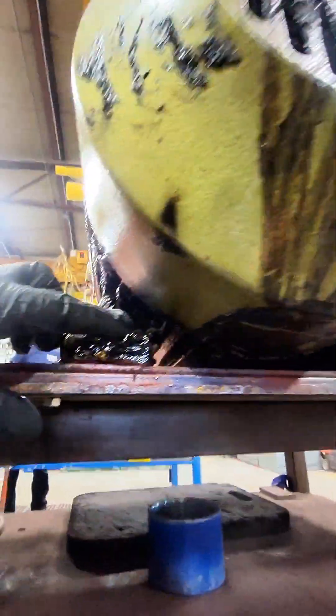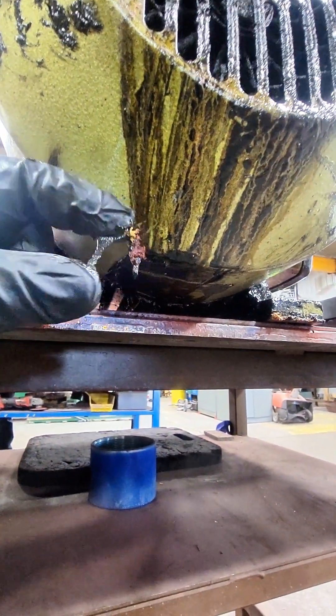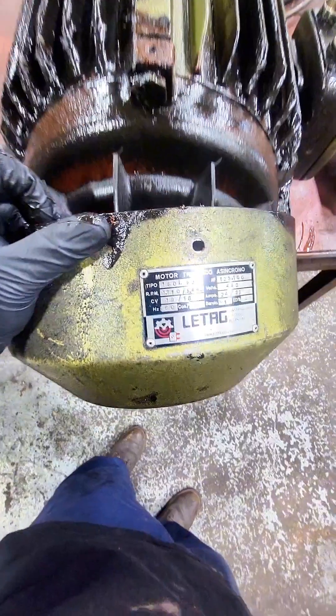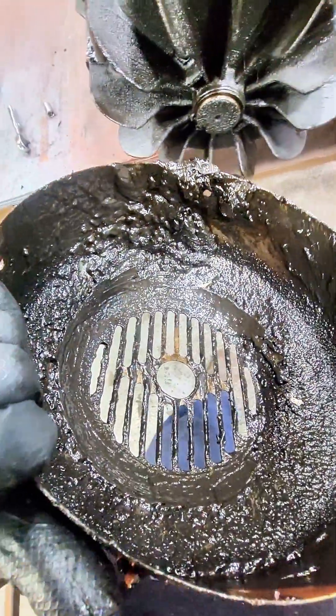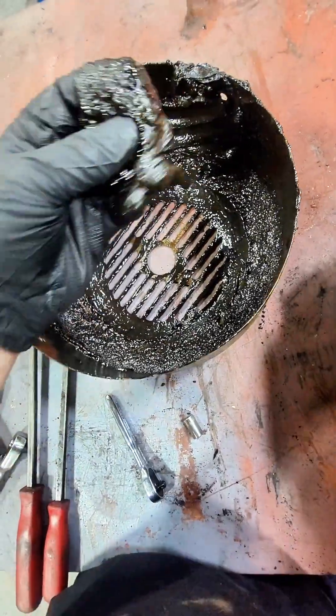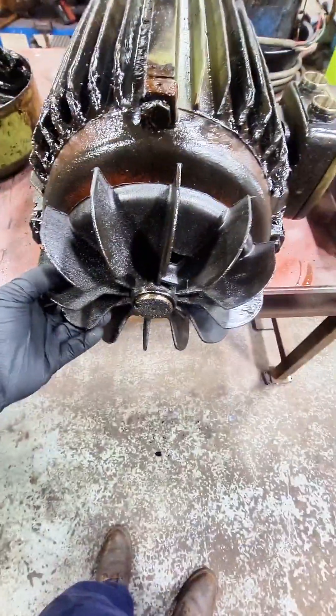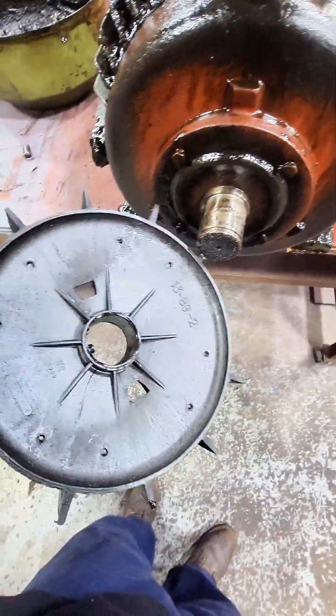This isn't from greasing the electric motor itself — something is leaking on this. It's sticky, it's nasty, it's gross. And when we pull that fan cover off, we can see that a lot of that material is sitting right inside of this fan cover. It's going to increase the resistance of the rotor being able to turn if the fan is hitting this material inside that fan cover, and over time it's going to damage the fan.